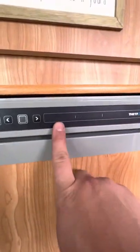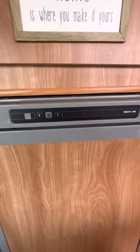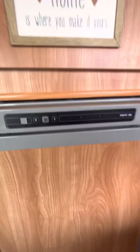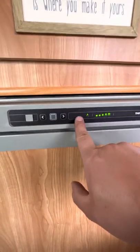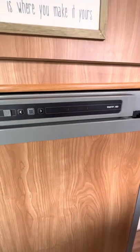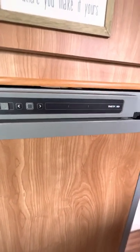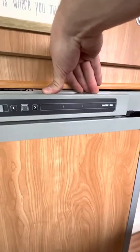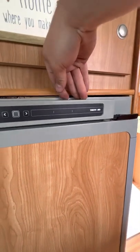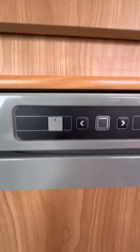The 12V symbol is for when your engine is running only. To get the fridge working properly — same for all motorhome fridges — you need to get it cold first via gas or 240V hookup, then change over to 12V once it's already cold. The reason is the 12V element won't get the fridge cold on its own; it'll only hold a temperature. To turn it off, push and hold the off button and that's it — no more green light.